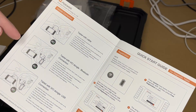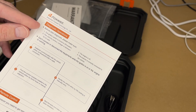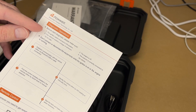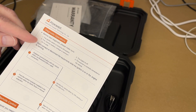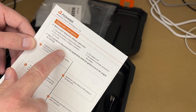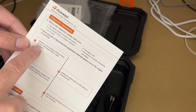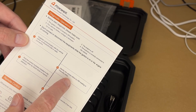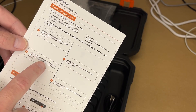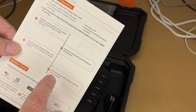This scanner uses Bluetooth and talks about registering and updating your scanner. For diagnostic operations: make sure the ignition is turned to on with the engine off, battery voltage is between 10 and 14 volts, and the scanner is correctly connected. Don't connect or disconnect while the ignition is on or the engine is running. Identify the vehicle by VIN or manually, then find control modules via quick scan or manual selection.